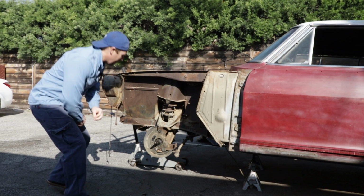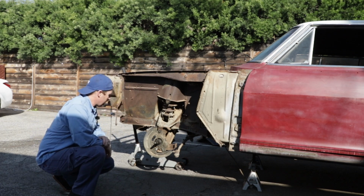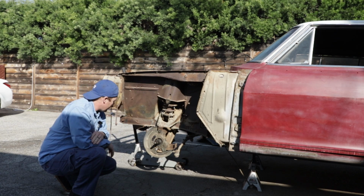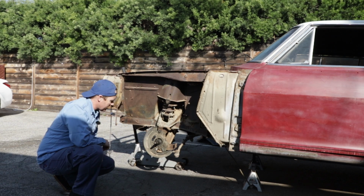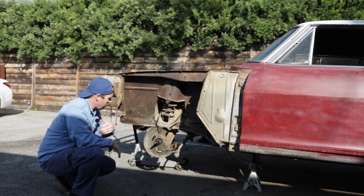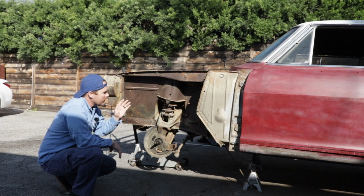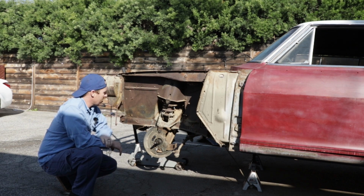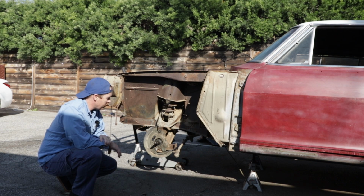So today I am aiming to go ahead and pull all the front suspension off. Take the covers off, disconnect the tie rod, disconnect the lower arm stabilizer. I'm sure it's got another name, but then try to drop out the spring and everything and pull that out. Do that on both sides. And then apparently there was a beehive in here. I'm going to show you guys. But then I'm going to go ahead and try to clean up all this metal best I can. Hit some of it with some rust encapsulator, hit some other pieces with some paint, just so it's clean and nice for when it goes back together, and see what we can get done today.